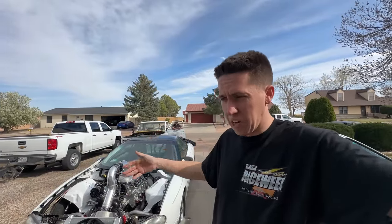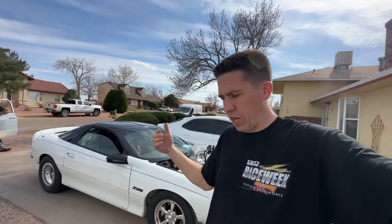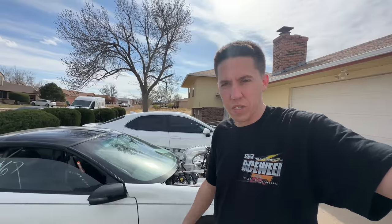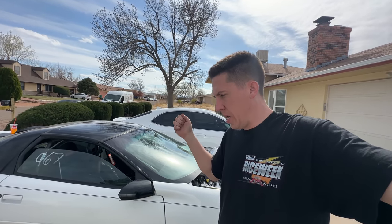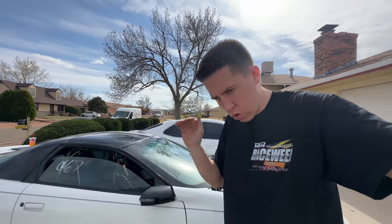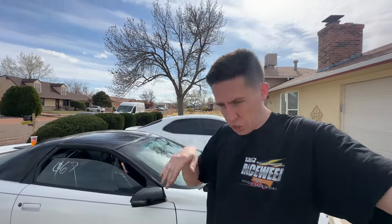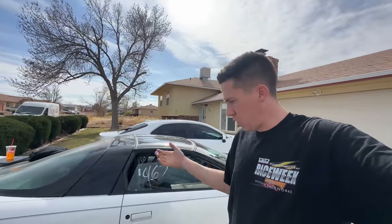Well guys, we actually ran to Wendy's and pulling through the stoplight, it's like the trans brake almost got turned on and the car almost came to a full stop. So I had clicking in second, driving in the parking lot. We checked fluid — everything seems good, we even added a little just in case. It showed fine in second and third gear, super happy. The car drives fine except in first — it's almost like it's dragging kind of weird. Second and third don't make that noise. It's almost like the trans brake is trying to apply while driving, which is really weird.